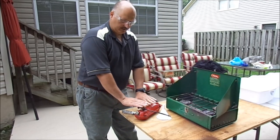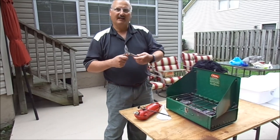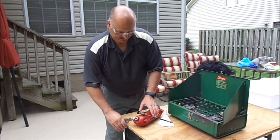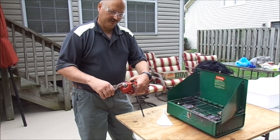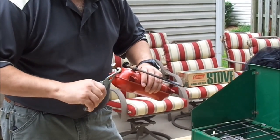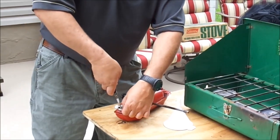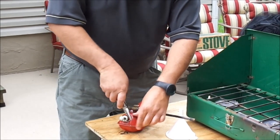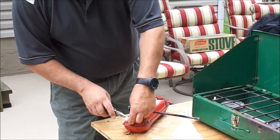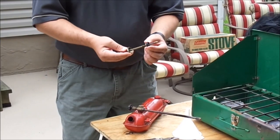Two, if you have any, you've got your fuel tank here. In here there's a little leather gasket. Use a pair of pliers — you see this little ring? You're going to take it off with your pliers. Just be gentle, it should pop right out. Now when you're doing this you should always wear eye protection, or as we in the military like to say, eye pro. Gently pop it, and here is the little leather gasket.